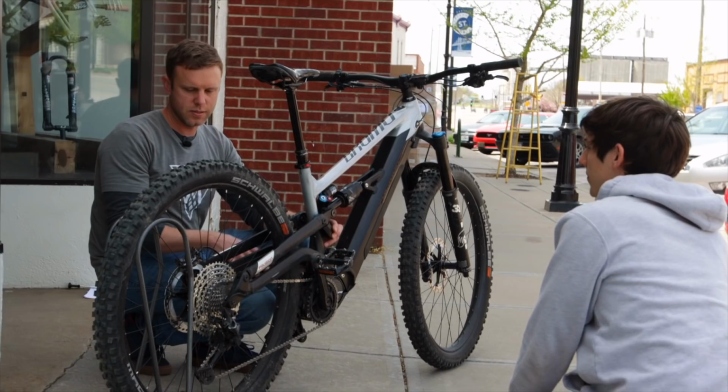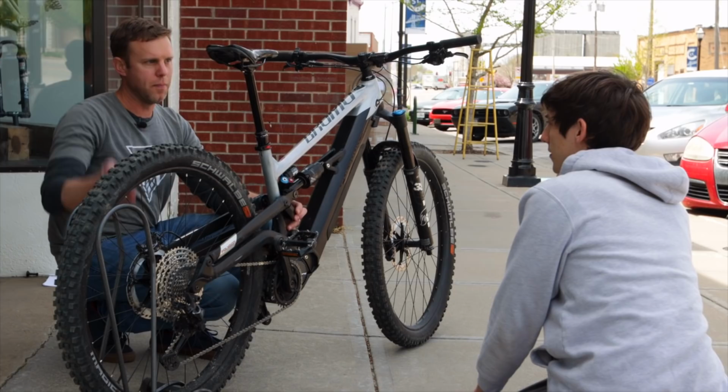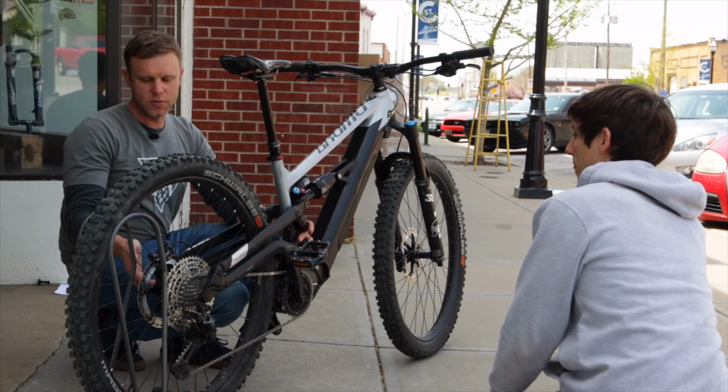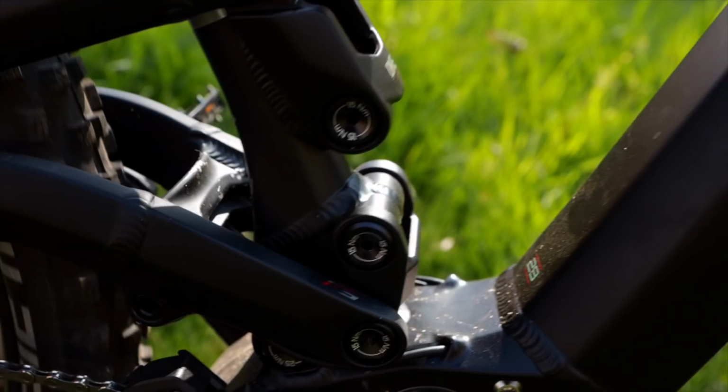And so in this case, we're watching where the axle goes when it compresses. You might think that it just goes straight up. This is a 140 bike. 160? 160. Yeah. So you might think it goes straight up 160 mil, or at an angle 160 mil. It's actually sometimes like an arc. It might actually go backwards and then arc. Essentially, all these linkages cause the rear axle to move in a way that, in theory, should be not only great for pedaling, but also perform really well with square-edged hits like big chunky rock gardens and things that compress the suspension quickly.